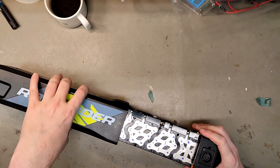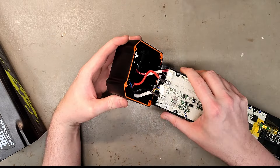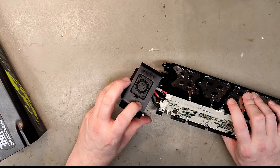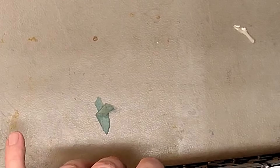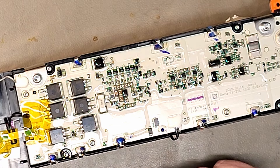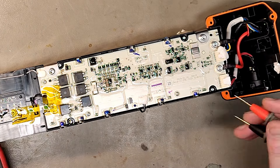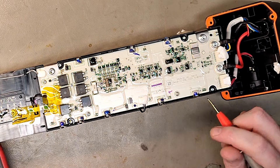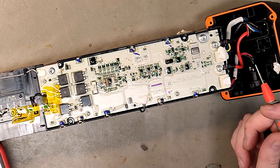It just has positive and negative charging in an XLR form, which is cool, but it does have communication with the e-bike. There is an LED blinking here and it's not a red light of death. We don't have any charger, but we could manufacture one. It does say C-minus and C-positive, no indication of anything else. It has six terminals but only four are connected, so you probably want a safety gap in between.